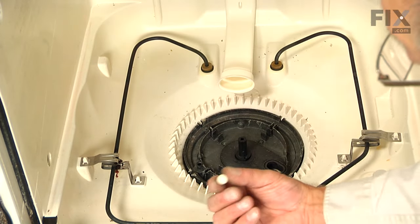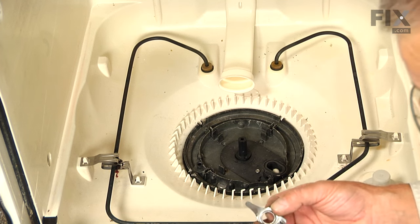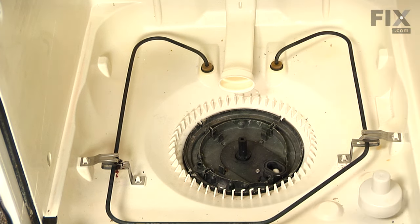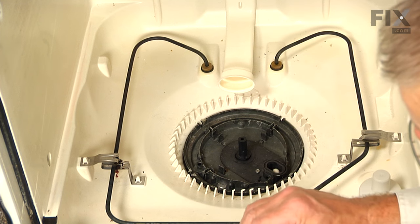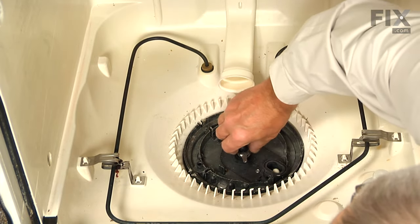The next step will be to drop the second check ball into that oval opening, and we're going to install the cutter blade and spring. We'll insert the straight end of that spring into the opening in that chopper blade. Next, we'll install the spring and chopper blade assembly — take the spring with the hook end down, the straight end going into that looped opening, and the chopper will sit on top of that. Then we'll put the hook end into the notch in that drain impeller and make sure it sits down into it.